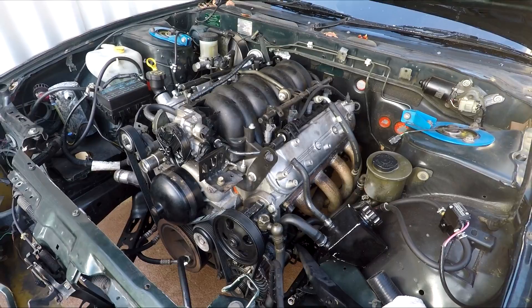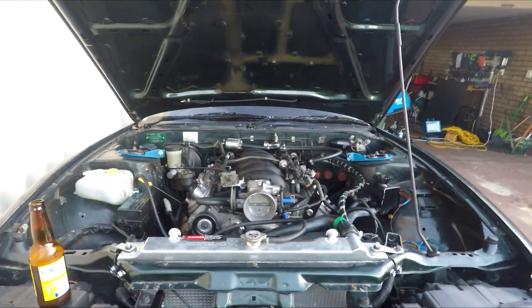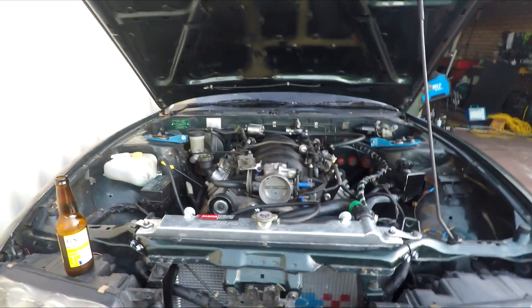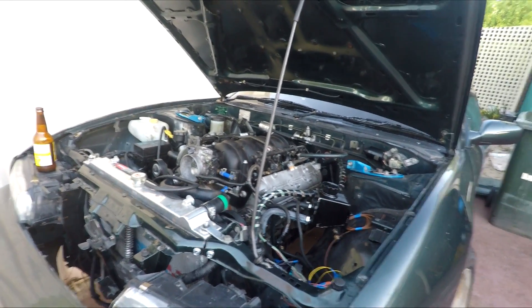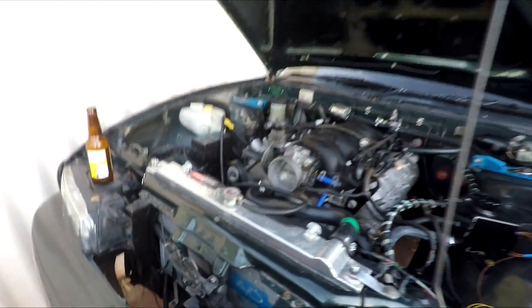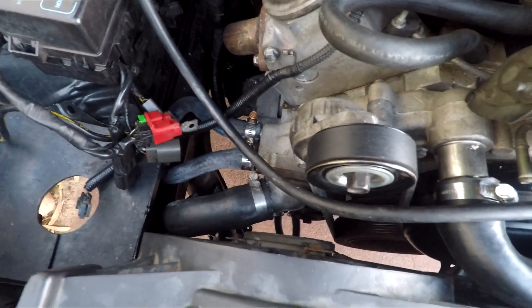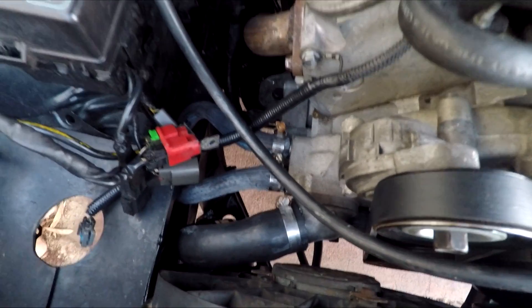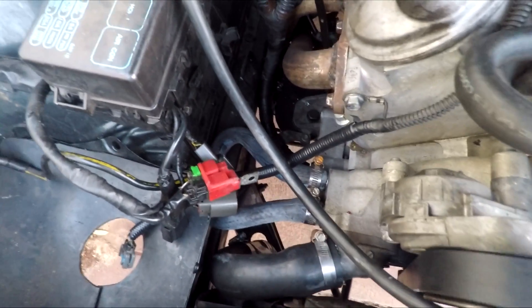So it's getting down to the nitty-gritties now. This looks a bit different - I did a lot of work on this overnight so it was hard to film, and I also did a follow-up video but found out later I didn't have my microphone turned on, sorry about that. As you can see, I've got all the front end on, the trans cooler lines done with some transmission hose, the AU thermo fans on with pretty good clearance. The bottom radiator hose is a concoction of two different hoses joined together with a temperature sensor fitting in the middle.